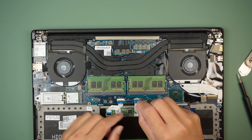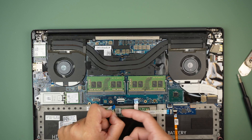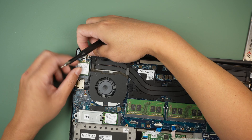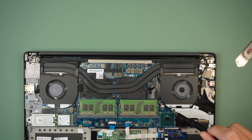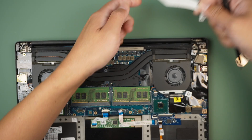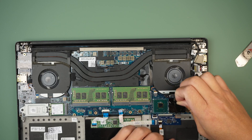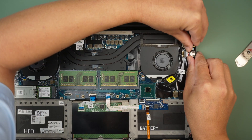Let's try to disconnect some of the cables — the trackpad. Disconnect the Wi-Fi here. The white cable is on the left, the black cable is on the right. Disconnect — slide that Wi-Fi out because we need to remove the LCD screen and transfer over. We need to remove the bracket and disconnect the LCD cable here by simply lifting straight up. They're kind of like Lego — to remove just pull straight up. And that is the charging port here — let's push it to the right.